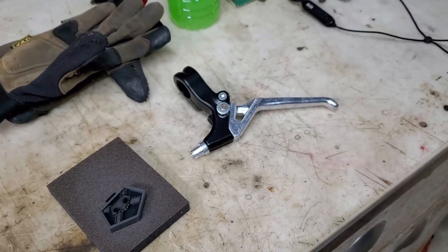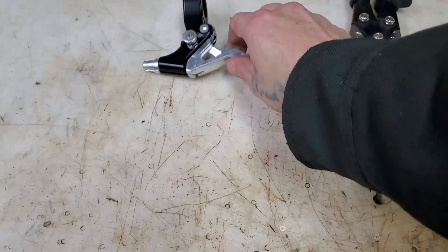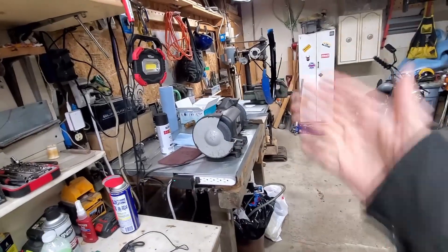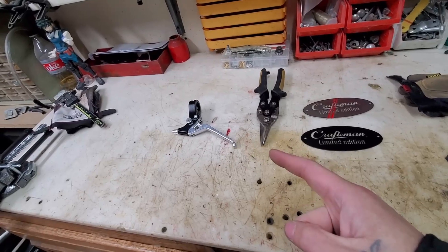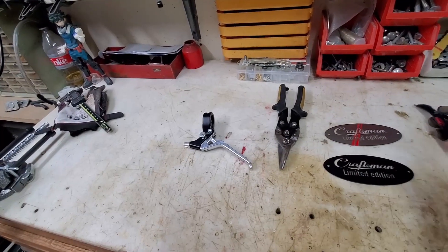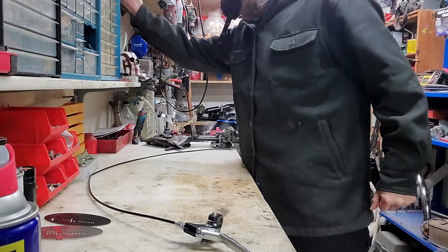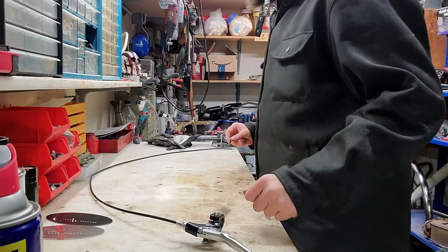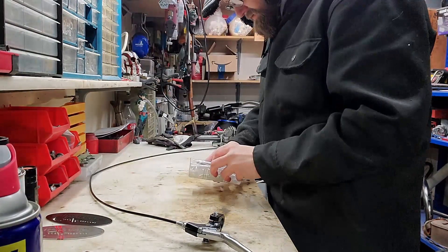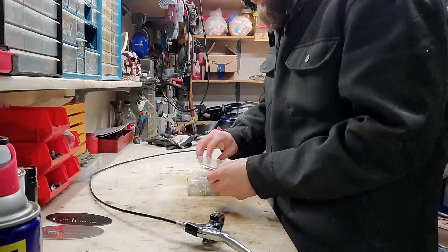While the paint's drying on the fender over there, I think I might go through and attach — well, focus — so I got this clutch lever that I put the pin in, and I brought it down here. While the paint's drying I can sort of run the clutch lever through there. I got little caps to crimp on the ends of the actual cable so everything sort of looks neat and buttons together nicely. And then I figured I'd show you these little aluminum cable caps.